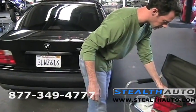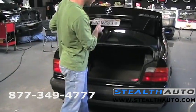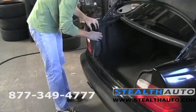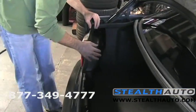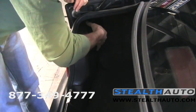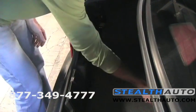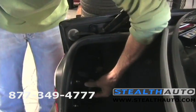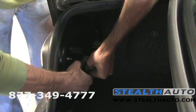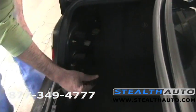The taillights are also pretty easy to install. BMW in general is fairly straightforward when it comes to installations, especially the older models. What you're going to do is first pull off this plastic panel that's on the back of the taillight — that's done by turning it half a turn counterclockwise and pulling the whole plastic piece off. Next, take this wiring harness, squeeze the top and the bottom, wiggle it and pull it outwards, and it'll pop off.